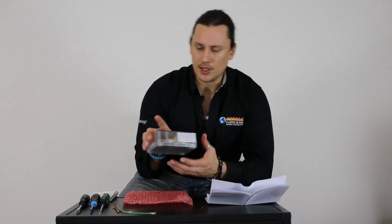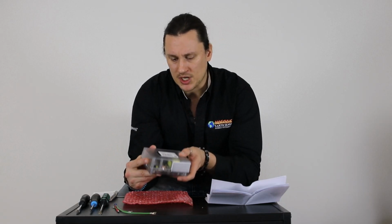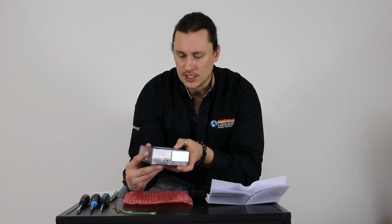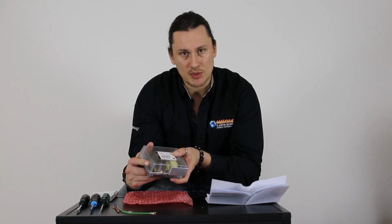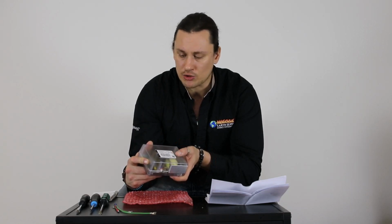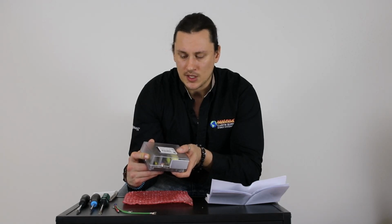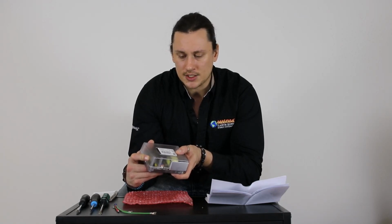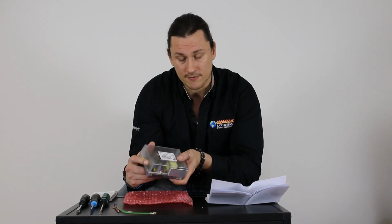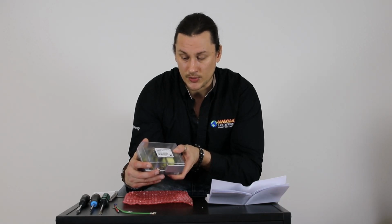Essentially, as I look at the control board here, this particular control board is going to replace the previous digital control boards for QuadraFire, at least for the 3-speed model. The original Mount Vernon will actually have a 4-speed control board. It looks similar to this, but the setup of that one is different. So if you need instructions on that or need a link to that, just comment in the video here. We're happy to provide assistance on the 4-speed board. But for right now, we want to just cover the basics on the 3-speed.